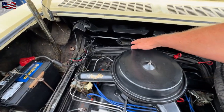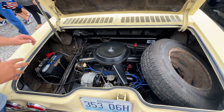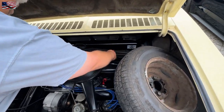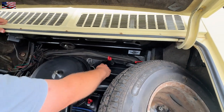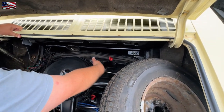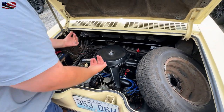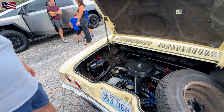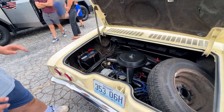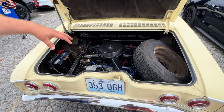Is this part of the heating duct? Yeah, and there's supposed to be a hose there. It's missing. It's supposed to take air from the shroud and pump it through here. It's capped off in here, otherwise you lose cooling air. It's a very difficult hose to replace because you've got to get way up back behind it. It's one of those things you learn to live with. It's not really functional, so a lot of the Corvair guys delete that hose or cap it off.